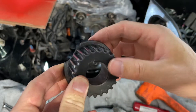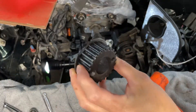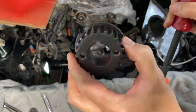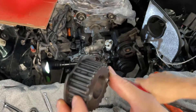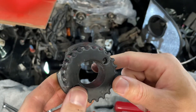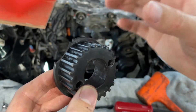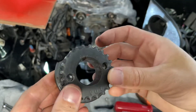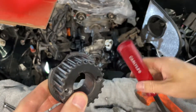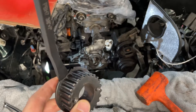As you can see, this thing is chipped. The reason why it's chipped is because one of the suggested methods for getting this thing off is actually prying it — using a pry bar, getting behind it, using the oil pump as leverage to push this thing out. If this thing did want to slide out, that might have been good enough. Now if you go on the forums, they say definitely don't do this, don't pry against your oil pump. I halfway disagree with that — if this thing was going to come out nice and easy, you can go ahead and pry against your oil pump, but just not using a ton of pressure. If it doesn't come off easily in a couple different areas, just give up there.